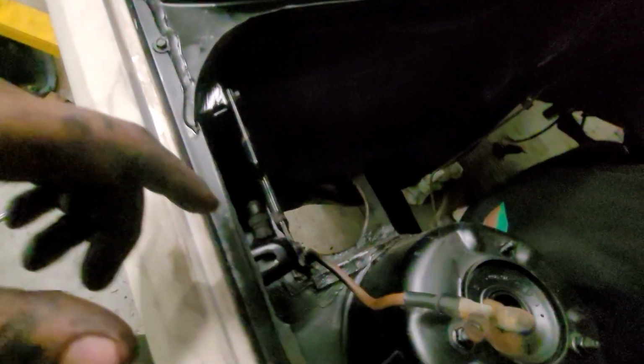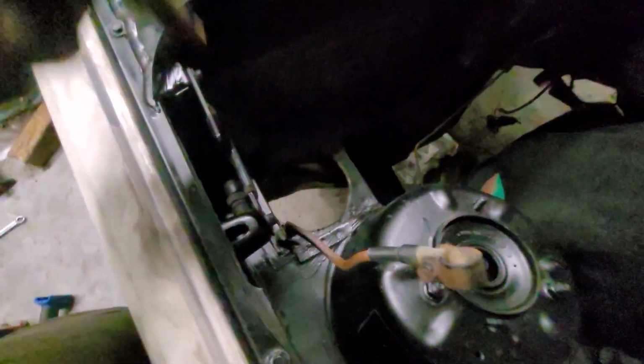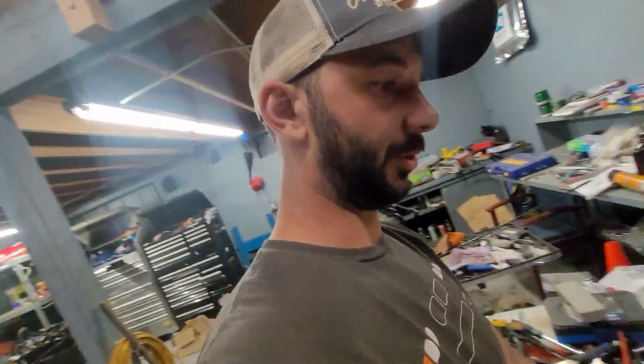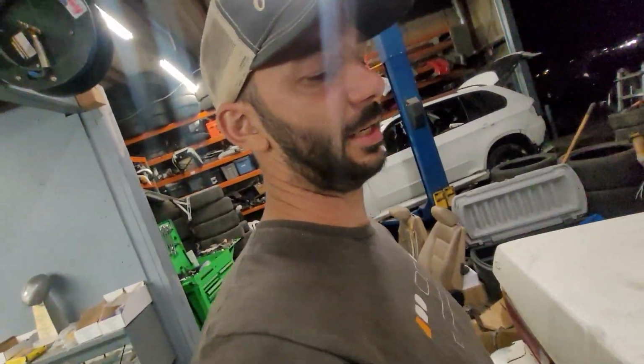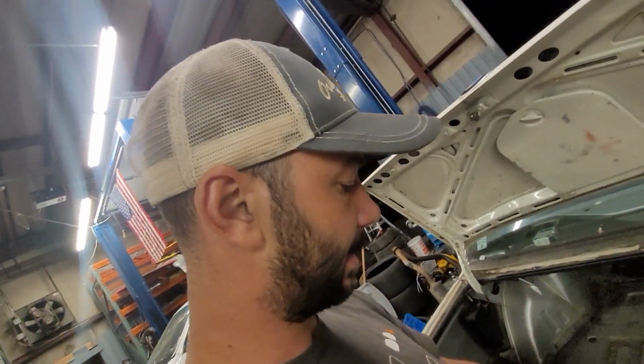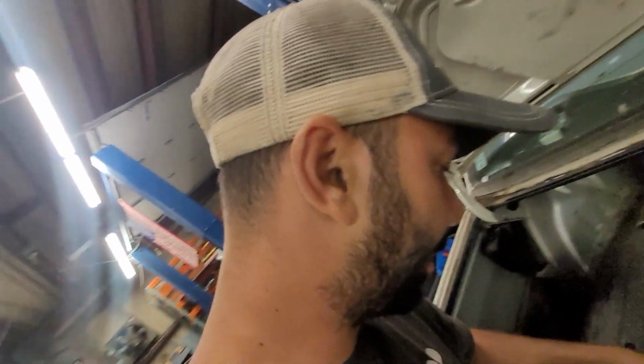Over here, this was an '84 318, so the battery was right there. Obviously, this is where our exhaust goes now. So we do the relocation. We pulled the wire out of another E30 that we scrapped, so we have the wire to go. I think maybe when I'm at OnTrack, I'll also get a battery box for it, because I don't really want to put it down in that hole. I'm thinking somewhere right about there with a battery cutoff would be great. And I just had trouble closing this. There we go, I figured it out.